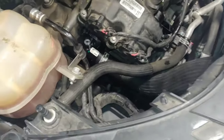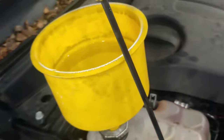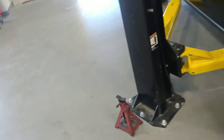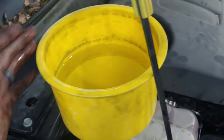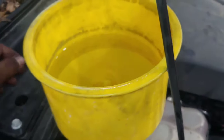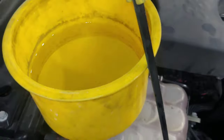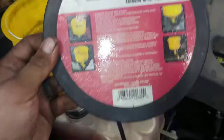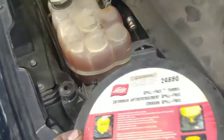I'm going to go ahead and fire it up — first I'll put some coolant in, then start it up and let it get hot. I've got this bleeder tool — it's like a giant funnel and it comes with a bunch of different fittings and radiator reservoir caps. You hook it up to wherever you fill the coolant, fill it up with water or coolant, let it run and get hot up to operating temperature so the thermostat opens. The bubbling you see is air in the system. The part number to this one is 24680 — I'll link this in the description too. It makes it a lot easier and you avoid air pockets and the chance of overheating in the future.